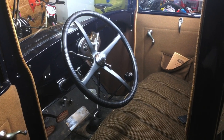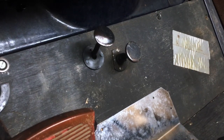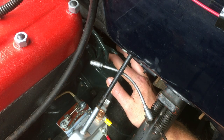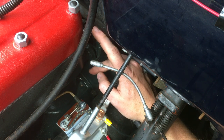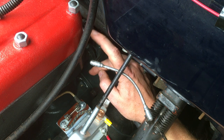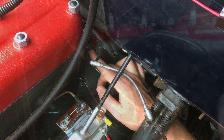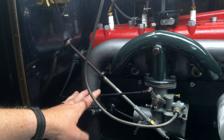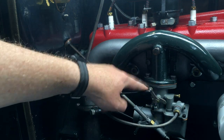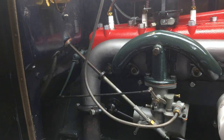In the Model A Ford, there are two ways to apply throttle. The most common way is to step on the accelerator. When you step on that pedal, you push on the accelerator pedal arm, which connects to the throttle arm right here, which pivots on a bracket — it's attached right back there, mounted to the back of the engine block — which comes out here and pushes on the carburetor rod. That carburetor rod then pushes on the carburetor throttle lever, which opens the butterfly valve, and that makes the car go putt, putt, putt down the road.